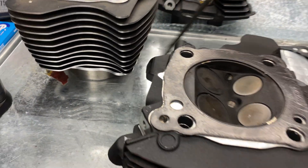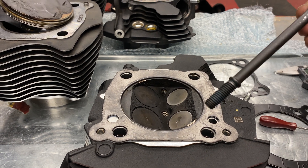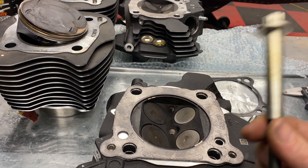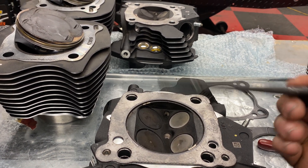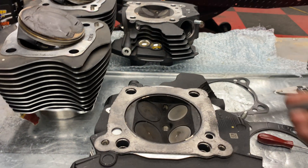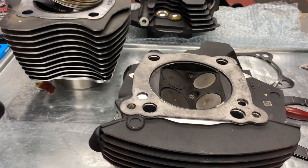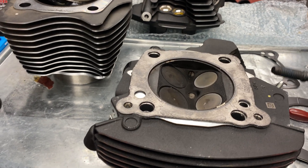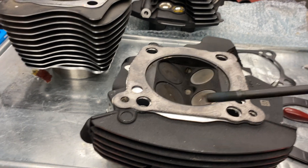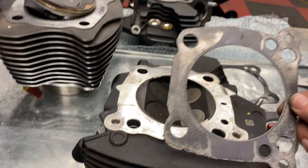Something else to factor in is how far the stud has been torqued at factory, and how much it's been torqued on the cylinder head bolt. These are torqued down at 45 foot-pound, and the final is also 45 foot-pound. So if we see an indifference anywhere — our clamp load, our force, our pressure in a square configuration — if there is an uneven torque pattern, we will see something happen with heat allowance, expansion, and cooling, which can cause the gasket to leak.